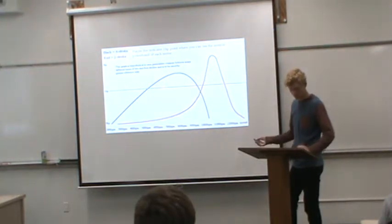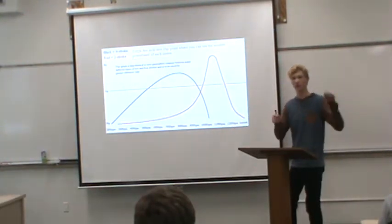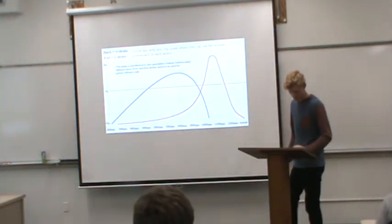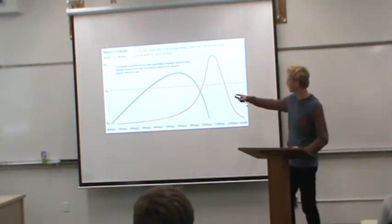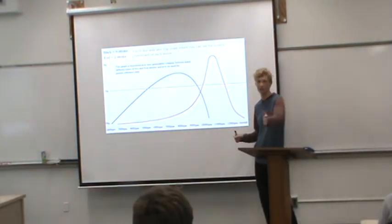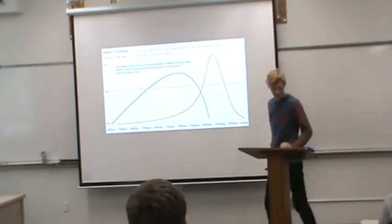The lighter weight means you can corner a lot better and stuff like that. You can maneuver the bike yourself, whereas with a four-stroke, you let it flow with wherever you're riding. With the two-stroke, you kind of move it yourself. And you want to keep it high in the revs by using your clutch, which basically lets you rev up the bike without giving it gas and flying away. And you want to stay right around here in the revs, so you have all this to use.